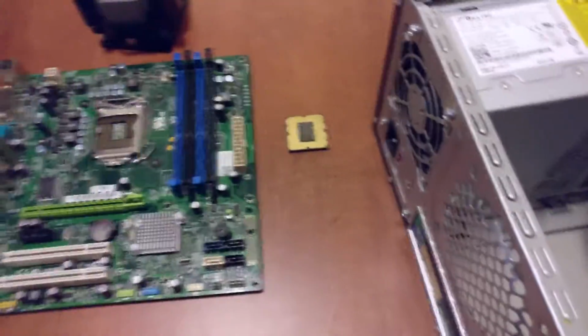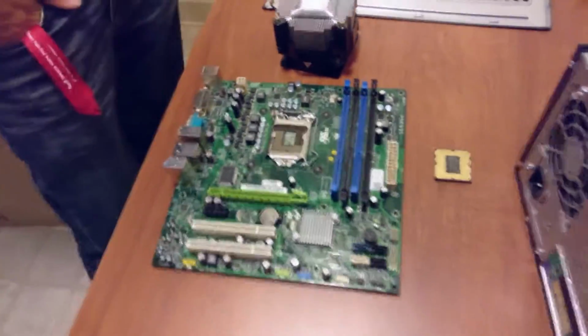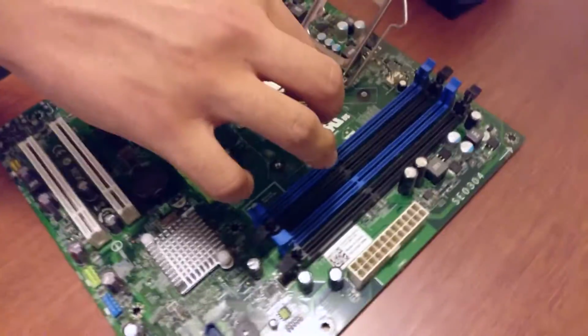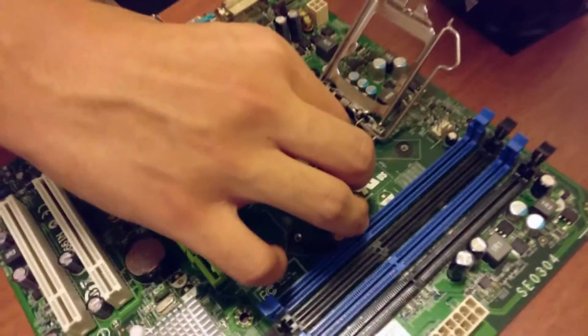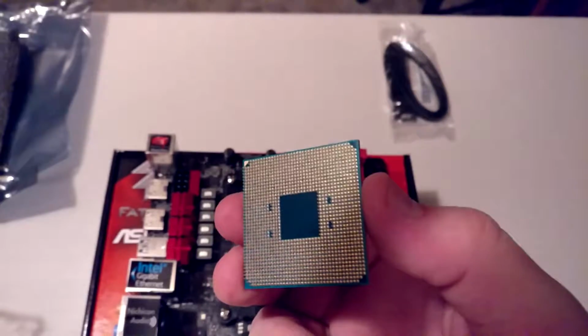So the first thing that you'll want to make sure of is that your CPU socket matches your motherboard. Now this is a consideration for modern systems. Older systems, if you're building on perhaps say the socket LGA775, not every CPU that fits into the socket works correctly, but if you're building a new computer with relatively new components, say within the past 5 years, you should be good by just matching these up. And if the sockets don't match, there's no way that your CPU is going to be able to plug into your motherboard.